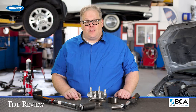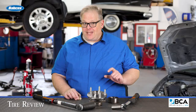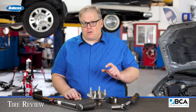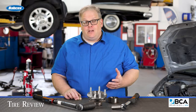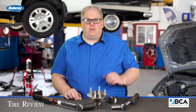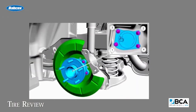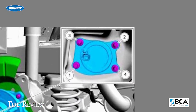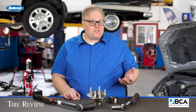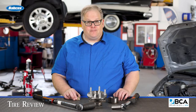To make sure that you're tightening down that axle nut to the precise torque specification, make sure your torque wrench is properly calibrated. Typically, if it's your own personal torque wrench, it should be calibrated annually. Also, make sure you're following the manufacturer's recommendations for the tightening sequence. It can be different for different manufacturers, and the torque spec can also vary a lot — anywhere from 95 foot-pounds all the way up to 250 foot-pounds depending on the application.